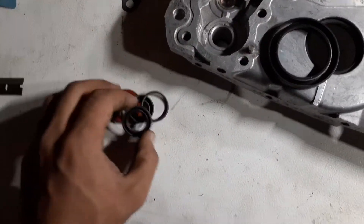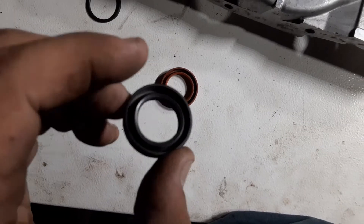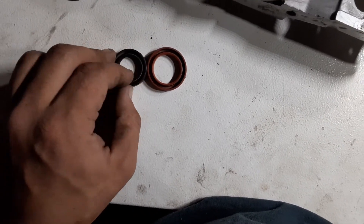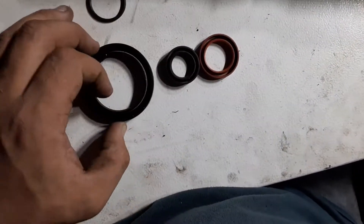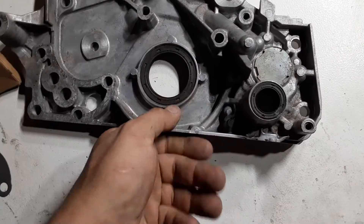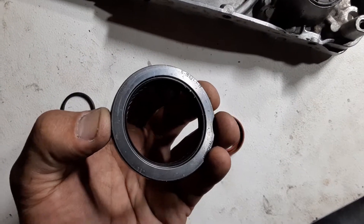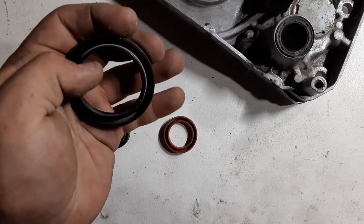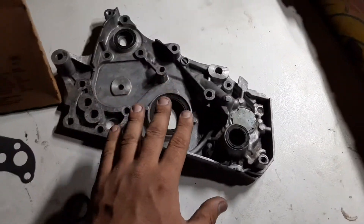One other tip I'll add: if you want to pound these in—all of the seals that go on the front case that have this spring on the inside—what you want to do is stick a dab of Mobile One bearing grease, or really thick grease, inside of all of them. The reason is because if you actually pound on these, there's a possibility that the spring could come out. I've actually seen it happen on a few motors I've built. When you're pounding in this seal you're applying so much force that metal and rubber—one of them's harder than the other—and the resonance from hitting it with a hammer is going to knock the spring loose. Putting that extra grease inside is a little bit of insurance.